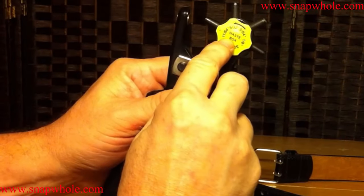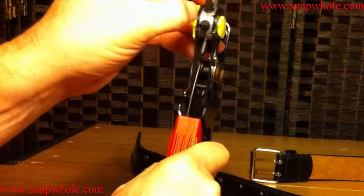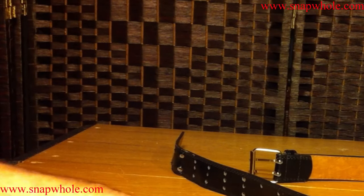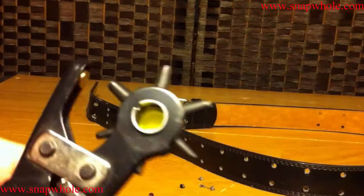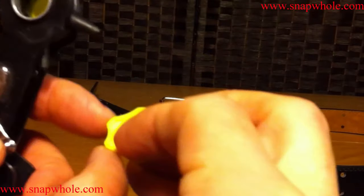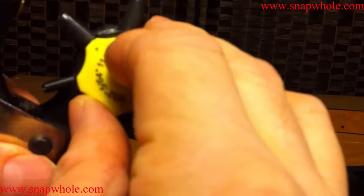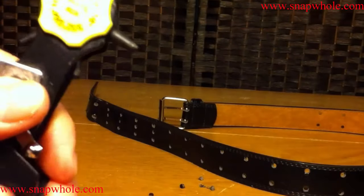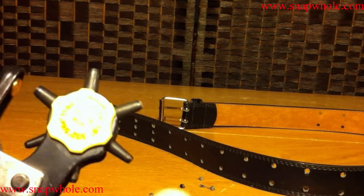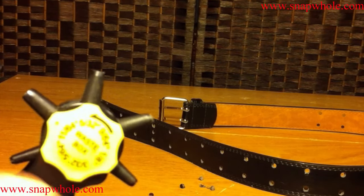It has what it calls a waste box, and this can be a bear to get off the area because it fits perfect. When you remove it, all the waste holes come out — that's perfectly fine, you're going to put this back on. They've also put a key on here, a little indexer, and that keeps it in the right place so it goes right back on. It's convenient that it lets you empty them all at once rather than have them go everywhere. It keeps the nozzle from being clogged and allows you to push the waste back into the waste box, keeping it from jamming up.